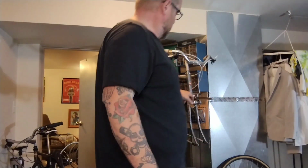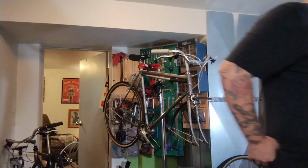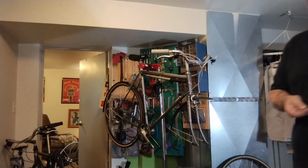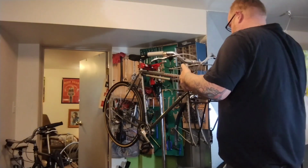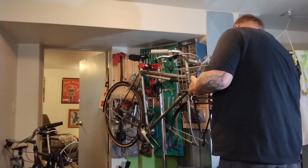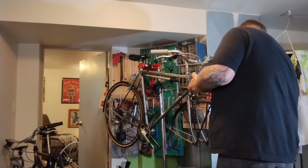The other less common but bigger size, for racks and brakes and some old braze-ons and stuff, is the M6 by 1 thread. It's good to have a little selection of both, especially longer stuff in the M6. I'm going to go with some big fatter ones too, to really slide around. Try to do this easiest one right up front, with the most room under the fender first. Let's see how it fits.